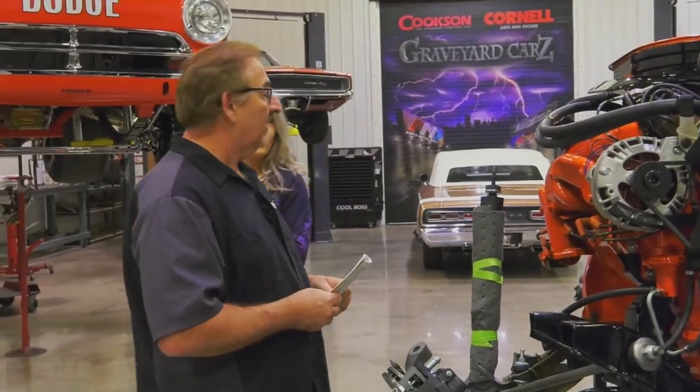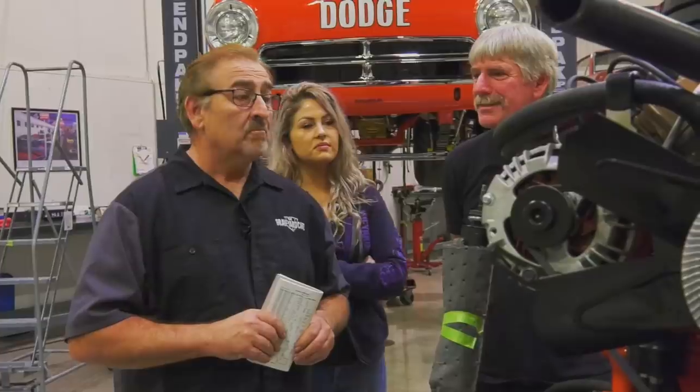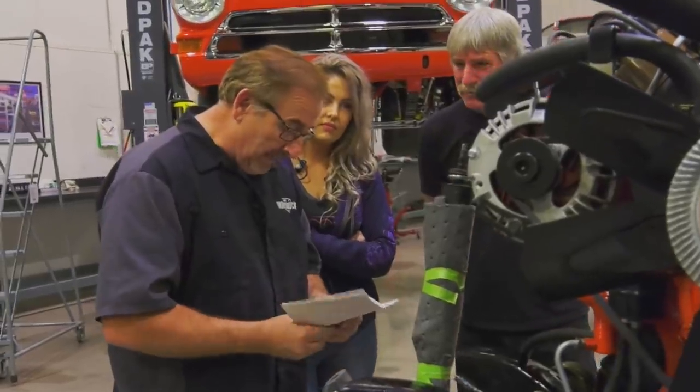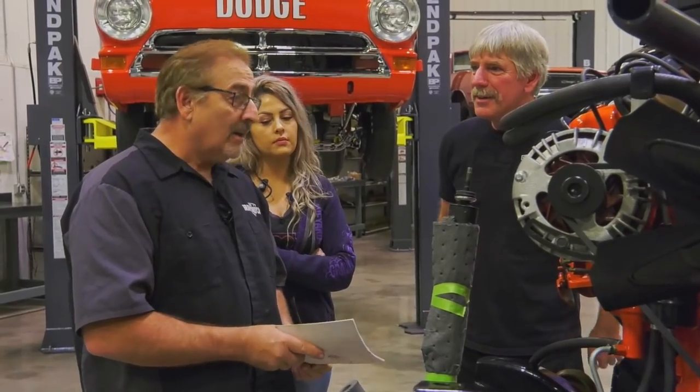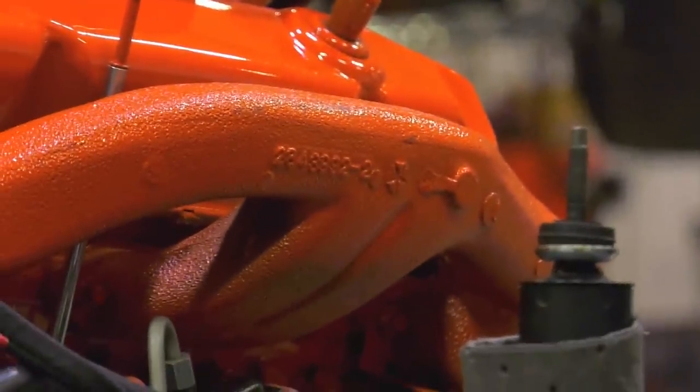What has happened? What's wrong with your face, Dad? 2806-800. No, it's 2806-900. Let's just take a look — a 2806 — let's go back here and find it. That is a B and C body 440 and 383 HP manifold for the right-hand side, and this is a 1970 E-body. And on the other side — 2843392 — wow, hey, you're consistent. That is the left-hand side, a 440 and 383 HP 1968 and '69 B body. So somebody really is going to like those — I'll tell you who's not.